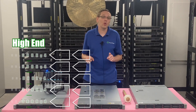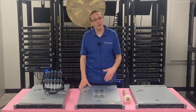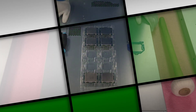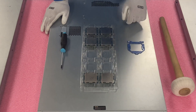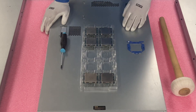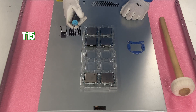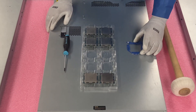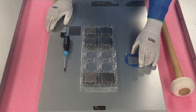Now we're going to show you how to remove your old processor and install a new one — two different ways to do that. HP has a blue clip they recommend using; you don't necessarily need it, but we can show you both methods. Before we start, I'm going to grab my ESD gear. All right, ESD gear on — we are safe to work inside the machine. The new CPU we're upgrading to is the E5-2698V4. You'll need a T15 screwdriver to remove the heat sink, and there's the optional blue clip.